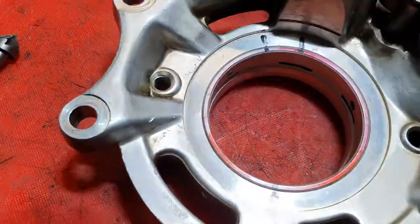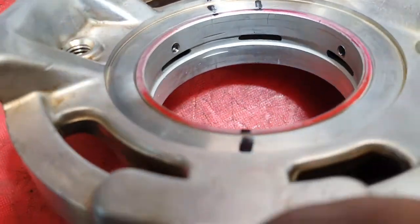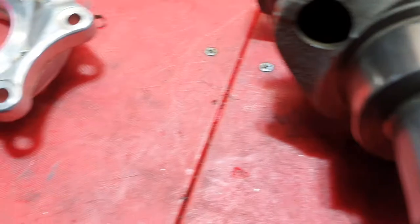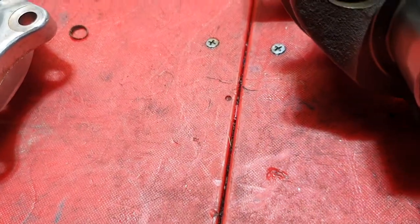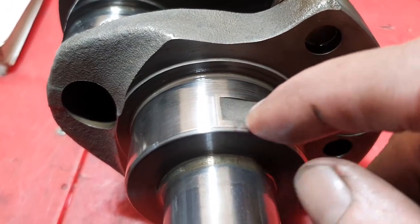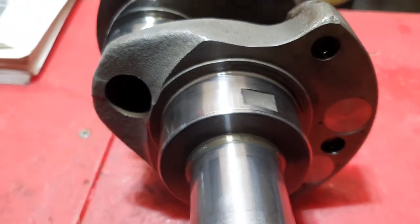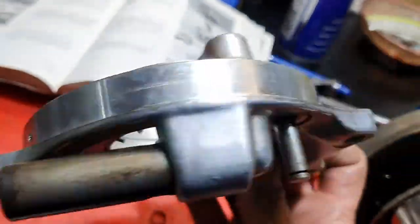Once you put them in, if you look up in there you'll see in the front part of the bearing there are two little holes. What they do is line up with this transfer port here on the crankshaft. That inside edge runs in the groove where the oil is pouring out of those slots at a great rate of knots, so oil is cascading all around the crank journal filling that little port up. Each time that port wipes past these two holes — kind of like here and here — they line up with a gallery that's bored out of the block. You can see the outlets of the two holes, one there and one there.